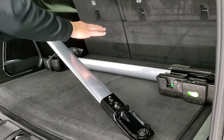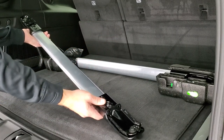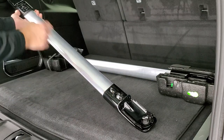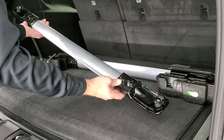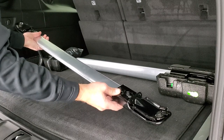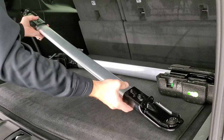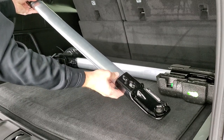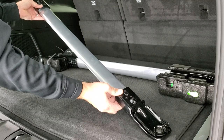These rails are exactly the same — there's no difference between one or the other. The biggest difference is how you're going to adjust them. There is an adjustment bolt right here and another one here, and that determines where you put them on top of the vehicle. If you slide both ends out, that's for the front. If you slide one in and one out, that's for the middle. And if you slide both in, that's for the back of the vehicle.